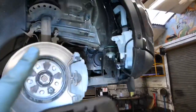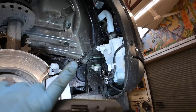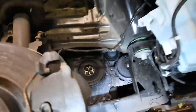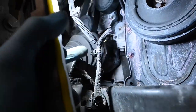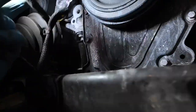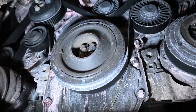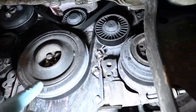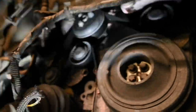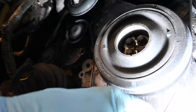This is the offside front of the vehicle. I've taken the wheel off and the inside wheel arch liner — it's only secured with a few plastic nuts, a couple of crossheads, and they come out really easily. Be careful when you take it off because there are a couple of wires attached to the side of the inner liner, so don't go ripping it out without checking they're disconnected first. This gives you a good view of the side of the engine: your crank pulley, a couple of idlers, your AC compressor, alternator, tensioner, and another idler.